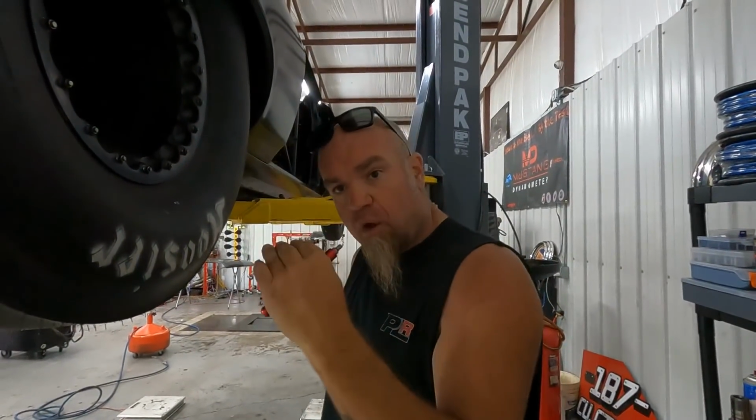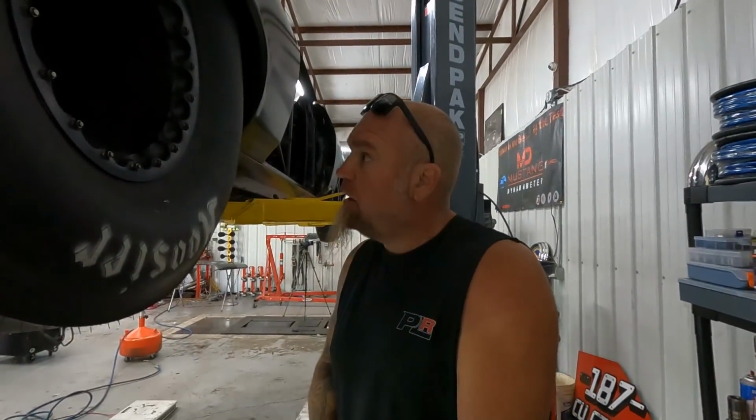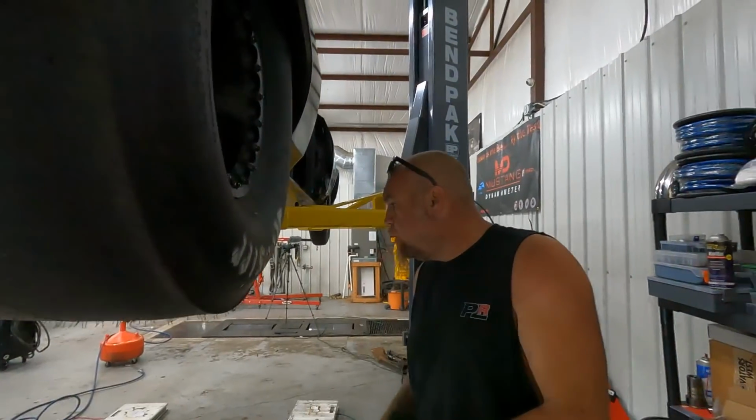So that's also going to lower it a little bit. We have to take into consideration everything that we're going to do with this. We're going to pile, let's just be honest, probably 200 pounds in the trunk. At least 150 is what we're going to put in the trunk. And if we're somewhere around 51 on the nose, so be it. That's better than 53. It's better than the 54 that it's at right now. Yeah, 53 and some change.